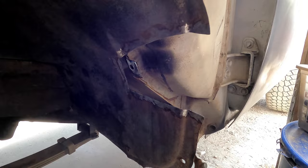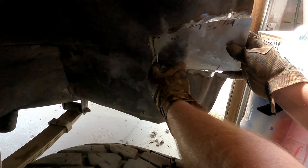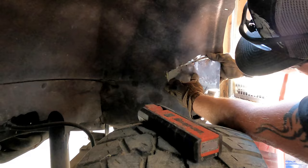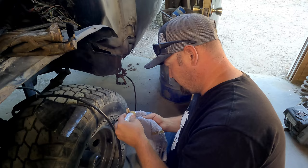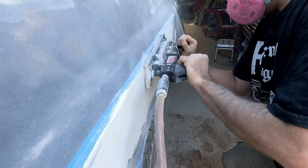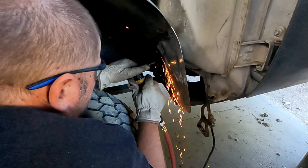That is a great-looking patch — let's go to the other side. We need to form another patch using a body hammer and a beater bag. With the difficult curvatures, you'll need to go back and forth from the truck to the beater bag, carefully making adjustments until you get the perfect fit to tack it in place. One thing to watch out for: we need to put a bolt through this patch. Jason has a cool trick using gloss enamel paint — put it on a towel, wipe it where you need it to imprint, press the patch against it, and voilà. Using a DA sander works great, but check out this Ingersoll Rand 315G straight-line air sander — it makes for easy work.